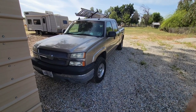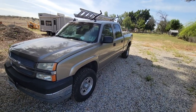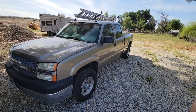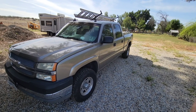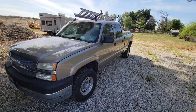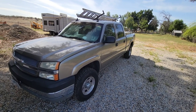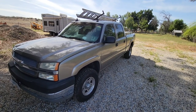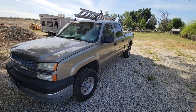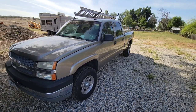One of the key things is to make sure your neighbors are happy. If you're going to do something like painting a whole pickup truck at home, probably do it in sections. Don't try to do the whole thing at once because you're going to end up with a lot of overspray. Maybe just do a front hood section, the whole front end, the middle section — do it in three sections. It'll make your life a lot easier, especially if it's your first time spraying.